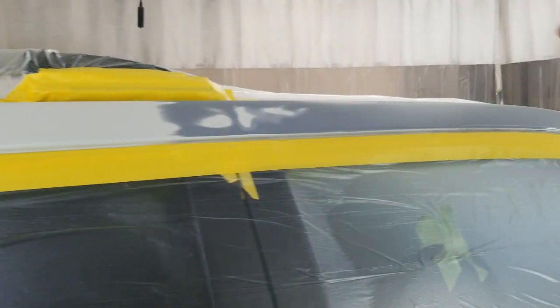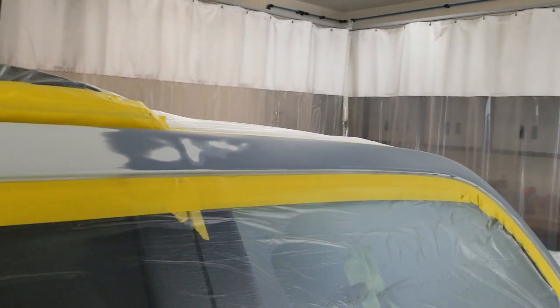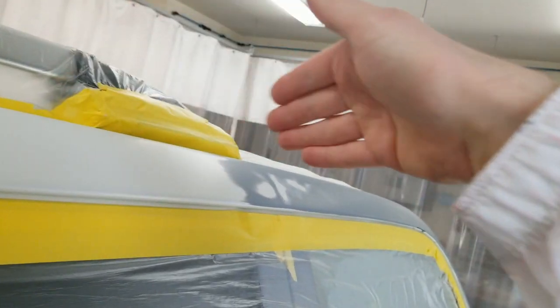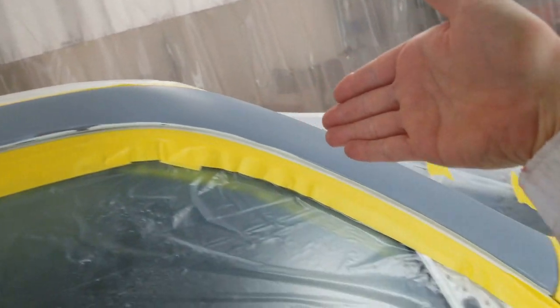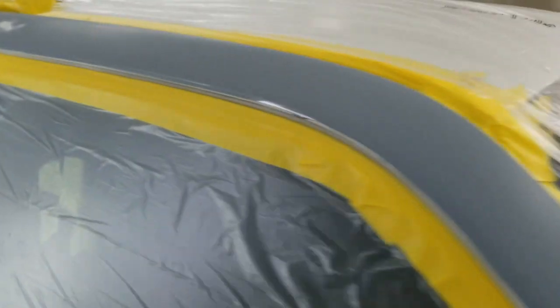and I'm going to have to seal this because it's so dark. I don't have any white primer, or I would have primed it in white. So I'm going to spray the sealer this direction to keep it off this area. I'm going to spray the sealer this way, and as I get over here I'll just get back to a normal angle and coat this with sealer in here, or out there and in here. So all this primer will get a coat of sealer.